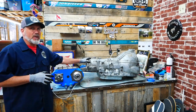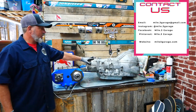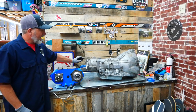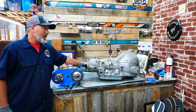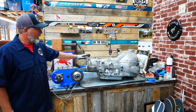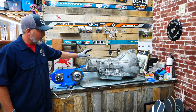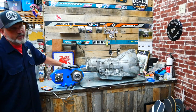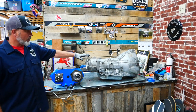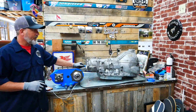One of the projects I've been working on over the last few months is the 4R70W rebuild. This transmission had probably close to 200,000 miles on it. We had to replace the tail shaft in it anyway so that it'll match up to the Dana 20. So everything had to come out of it. I went ahead and rebuilt it, put the new tail shaft in, put the adapter in, and then we rebuilt the Dana 20 and put the adapter in it as well. So this is all ready to go.